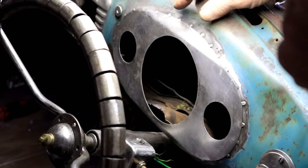Here's how I wired my dimmer switch. Power goes from the battery through the main fuse and its fuse in the fuse box — directly connected to the battery, not ignition-activated. From there power goes to my light switch, which when closed supplies power to my dimmer switch. If the dimmer switch is in the middle, nothing is happening. If I switch it one way, I activate the low beam relay; if I switch it the other way, I activate the high beam relay. So when I switch from low beam to high beam, you should hear the relay click. Park lights, high beam, low beam — it's working.